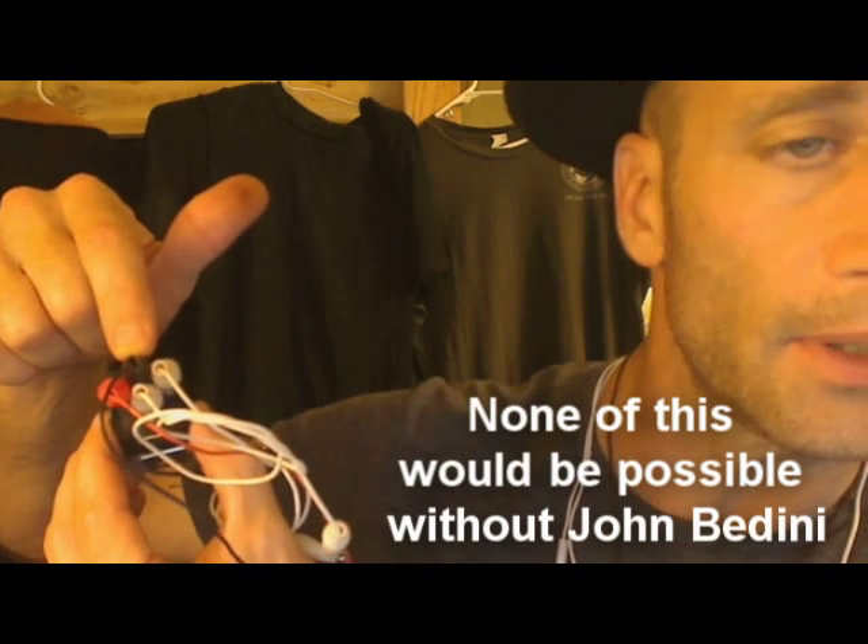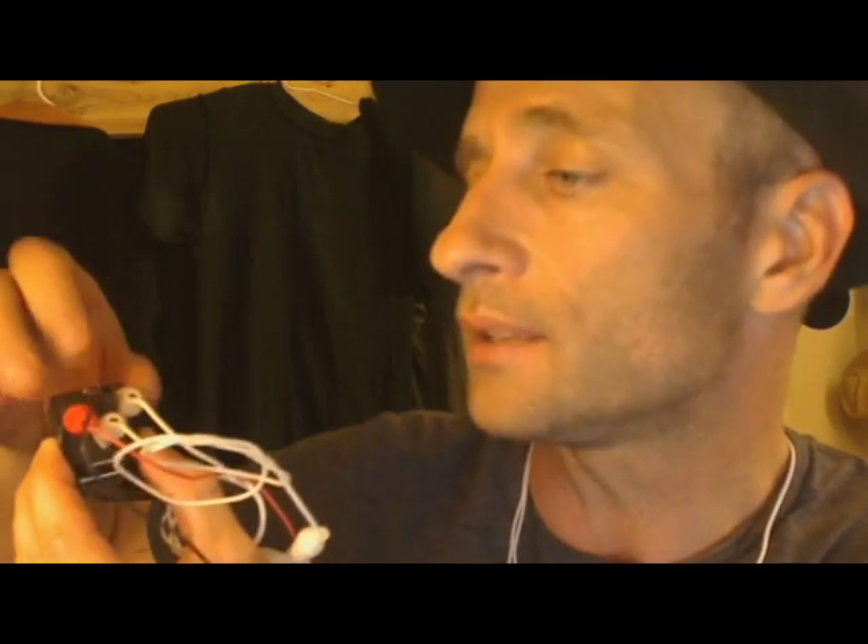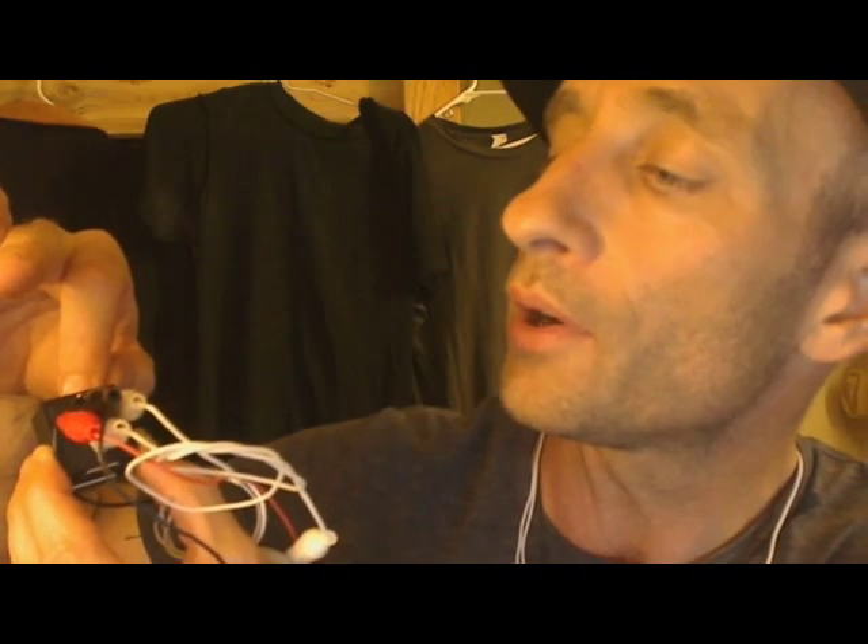I've got 85, 86, the number 30, and 87 here. The center post is going to be your negative. In Imhotep's video he had to open it up and solder another wire to the top bar and run that out through the case — we're not gonna have to do that because we got the Bosch type, which makes it easier to just clip them on.